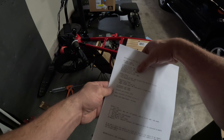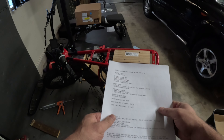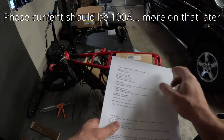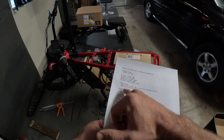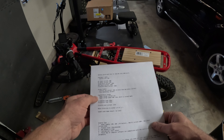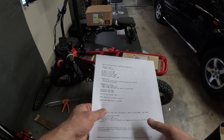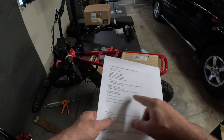I have some settings configured here. My boost limit and DC limit current are going to be the same as my 80 amp controller. I do have a 200 amp burst on the controller as well, so the phase current is going to be 200 amps and the max phase current is going to be 240 amps. The protected phase current is 300 amps. We want to enable the e-brake — the electric phase current of 50 amps, which is when we depress the brake. We're going to enable a 50 amp regen, which is pretty conservative. For regenerative charge, any time we let off the throttle we regen at 25 amps. The regen cuts off at essentially 5 miles per hour on this 16 inch wheel.